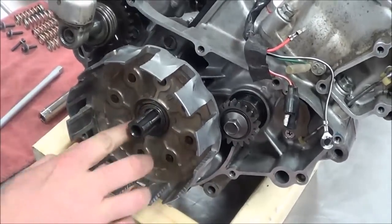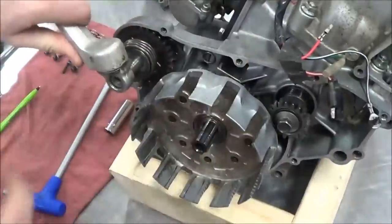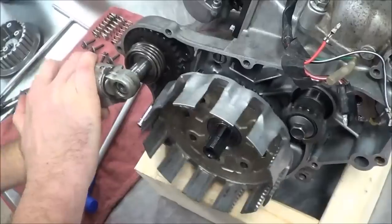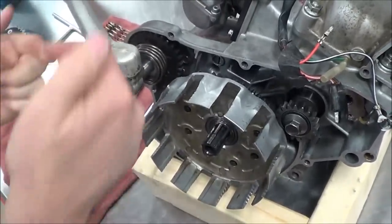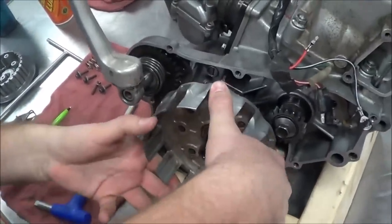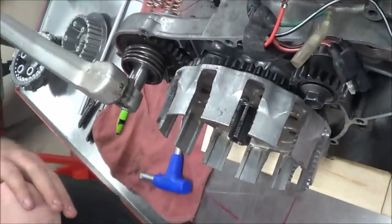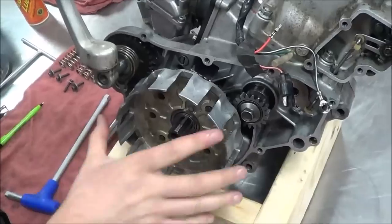So I'm fully seated in here, and now you'll be able to see the crankshaft actually turning. Oh, there's no piston in this. And now you can see that we're going the right direction to crank it over. So once you let off, it disengages that. So that means that these gears are still spinning all the time. And that's why we have to inspect those and look for, that the bushings are good and that there's not any metal-to-metal contact on that.